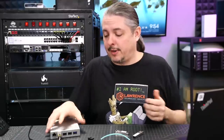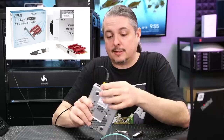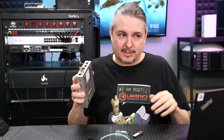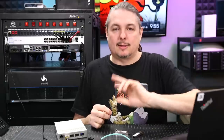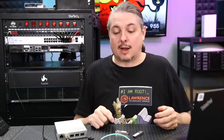For those wondering about the RJ45 SFP+ adapter — other than getting warm — I had it running for a couple of days. I plugged my computer in, which has an Asus card that supports 10 gig, and it connected at 10 gig perfectly fine. That's how I got it to reach 59°C, and it once hit 60°C with an ambient temperature of about 75°F in my server room. It was then connected via DAC to the UniFi 10 gig switch. Even under heavy data transfer it never got hotter. My computer is connected at 10 gig and all my video editing gets copied to the FreeNAS server, which is connected at 10 gig — it works perfectly fine.